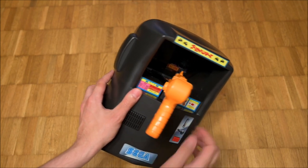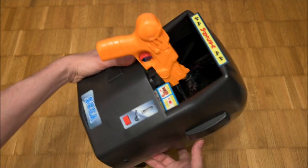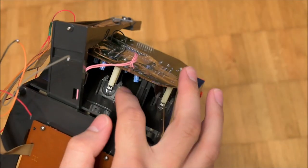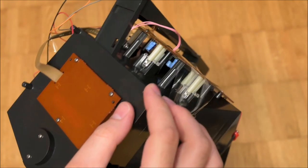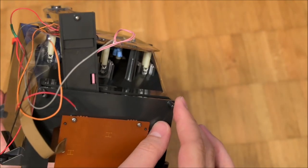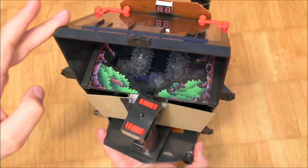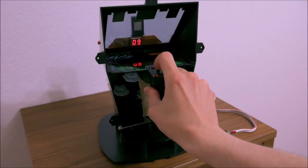Even though the game is called Ghost Hunters, the targets are not really spectres. In total there are five enemies: Frankenstein's monster, a mummy, a vampire, a werewolf, and a lagoon monster. Each target consists of two stacked light tubes which are illuminated via an LED at their bottom. The LEDs themselves rest on tall plastic stilts which support them on the PCB. The front tube is a cute looking detailed representation of a monster and is illuminated green. The back tubes are generic flash shapes which light up red upon being shot.